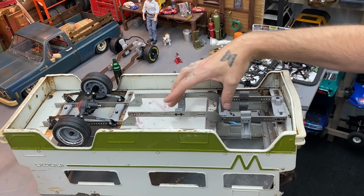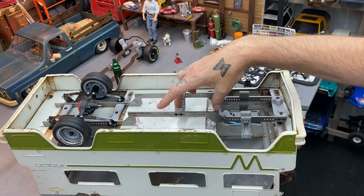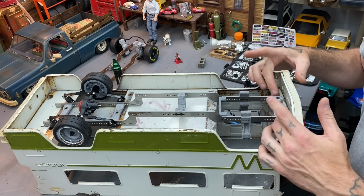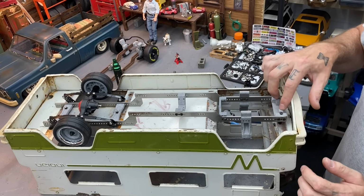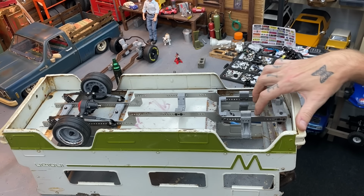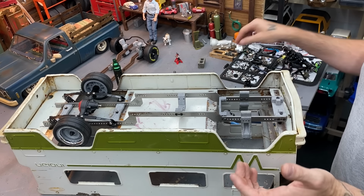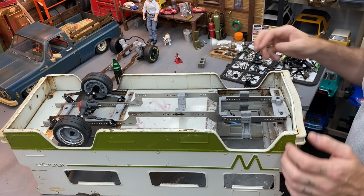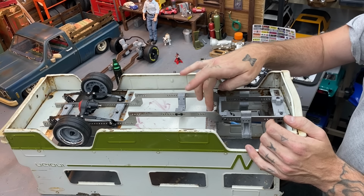I left the motor where it was on this chassis. This is the same mounting holes as the Scottsdale video calls for. I moved the front suspension mounts all the way forward, and I moved the servo mount all the way forward, which there's still a little bit of adjustability in that. Using the servo mount for our body mount, we can't really move it now, so we could always come back and do something else in the front too, like servo mounts, and bolt that to the chassis or the body in the same way. But that's one thing left to do.